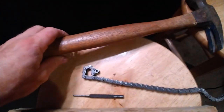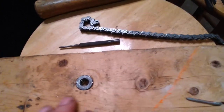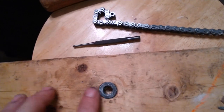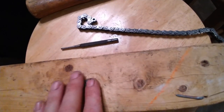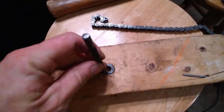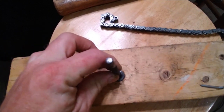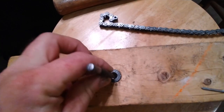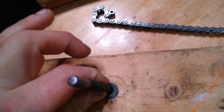Got your hammer, got your nail punch. Take a block of wood and pound a nut right into it — you want that hollow hole and a good level surface. Put your chain on there, put your link over that hole so when you get to pounding on it, that link connector has a way to push out. If you try to do this on concrete, you're gonna get nowhere fast.